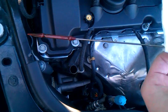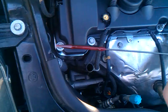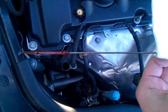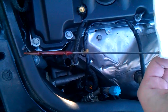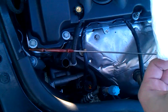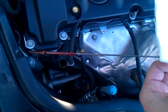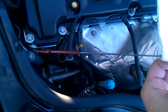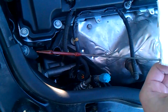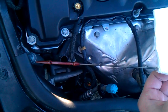Now, in this condition right about here that I'm showing you, where it seems per the markings on here between the high spot and the low spot, we're about half. That's about when you want to add a quart. So I hope this clears it up for you a little bit. And if you're still confused, there is an aftermarket dipstick available. It's a bit pricey, but I'll put a link to that in the description.